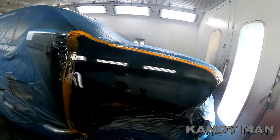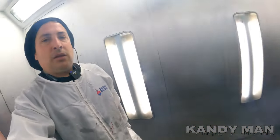Alright guys, the job came out good — no fish eyes. So if you ever get in a bind and think you've got a panel that needs this treatment, it'll definitely get you out of having fish eyes. If you're spraying water base, you can also do this with solvent base clear — just dust your panel and don't put it on wet, and it'll stop them too. I hope you guys liked this video, stay tuned for the next one.